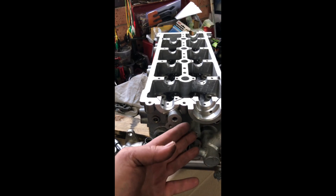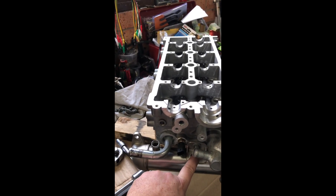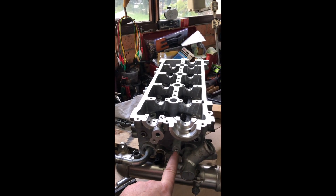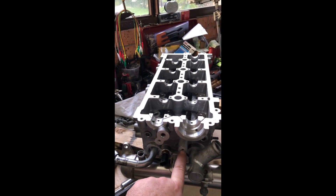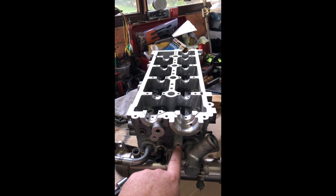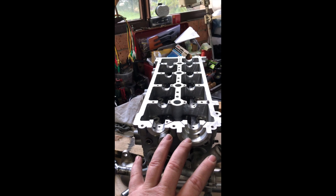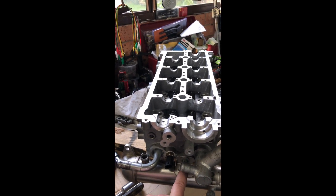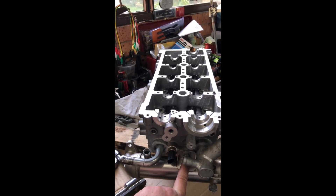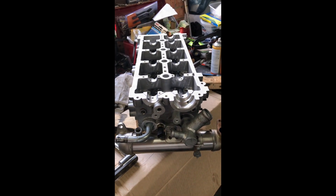The whole reason I'm building it up now onto the cylinder head is that's how I took it off, because it's so hard to get in on the back of the engine to undo all these bolts. In particular the vacuum pump one — it is so buried deep in there that it's very difficult to get out. I figured that's how I took it off, so I'll build it back up to put it back in. But I'll have to see how I can get a wrench in to tighten it up once the flanges are connected.